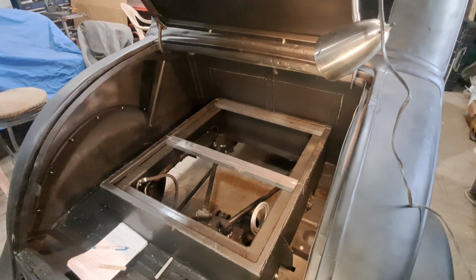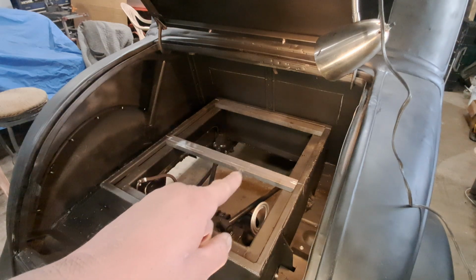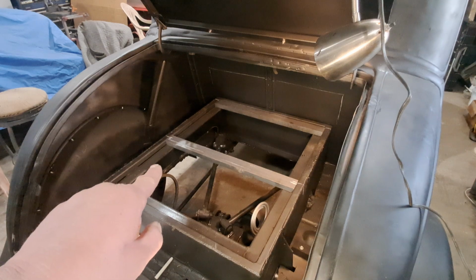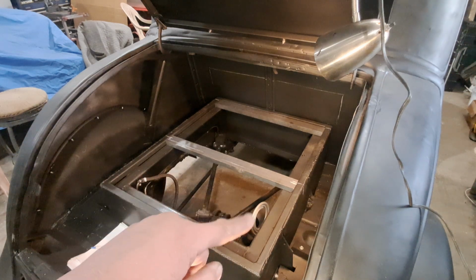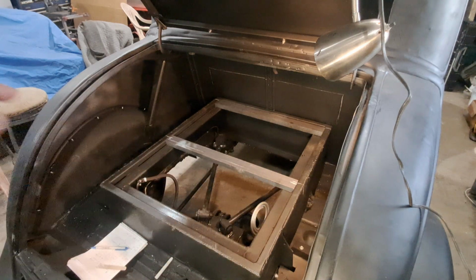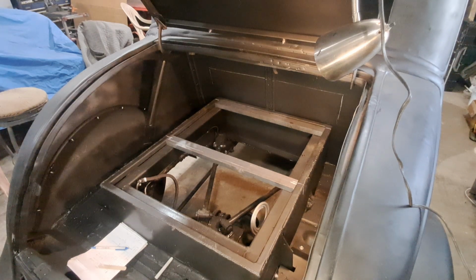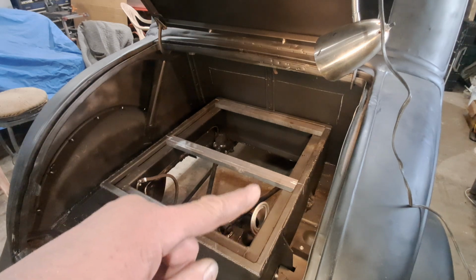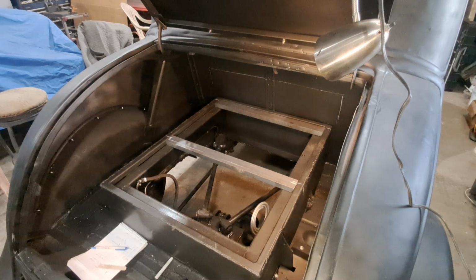The only problem is it's going to be noisy. Maybe I should cut that tin in half, maybe I'll cut that tin piece I made. We could weld this all down, and then on this side of it, maybe you can mount the fuel line on the rail, and then just screw down the tin. And if he's got to get to the fuel pump, he just pulls that piece of tin off with a seal on it, and then he can work on his fuel filter and fuel pump. You know what? I think that's probably going to be the best thing.